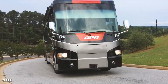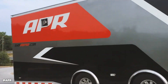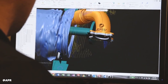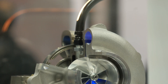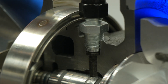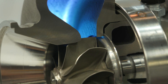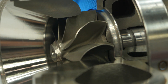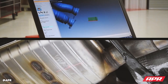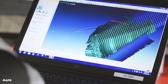The first thing we do is pull the car in. A lot of times we'll take the engine out, look at everything, and try to figure out what's going to break — what are the limits, where's plastic, where's metal. The team adds sensors to different parts of the car, like on the turbocharger for shaft speed, so we can see how fast the turbo is spinning and avoid over-spinning it. We also put sensors in the exhaust and turbine housing to look at pressures and temperatures coming out.